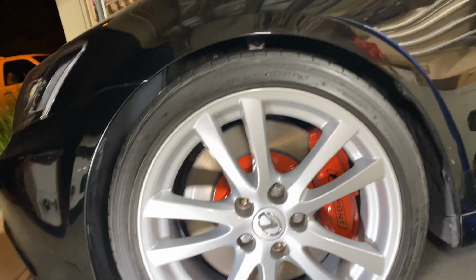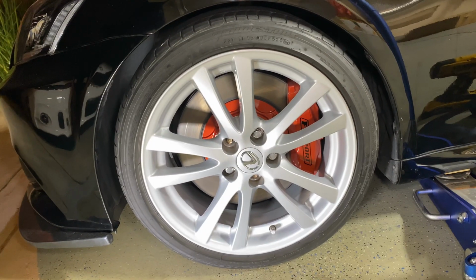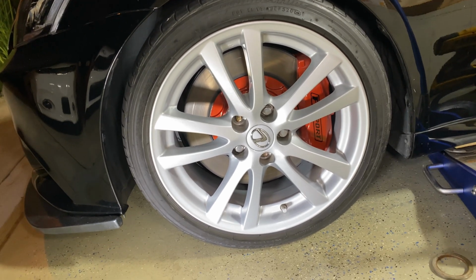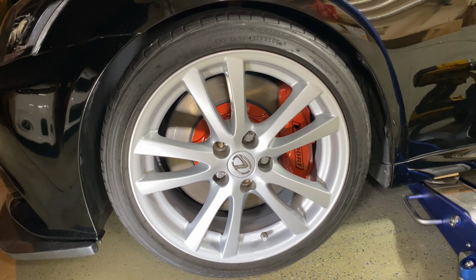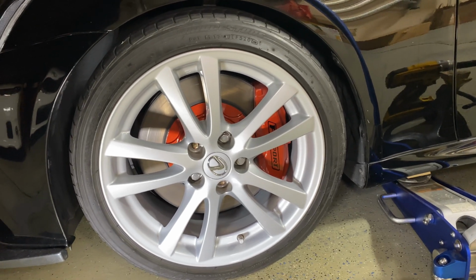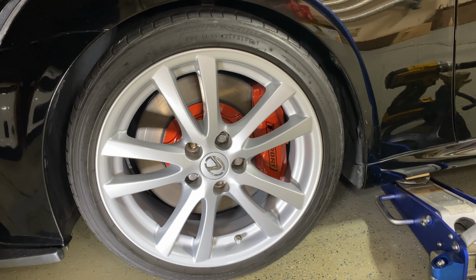Look at that, the wheel gap. I think when the suspension travels, it'll end up cambering in, so it won't rub as much. But if it fits my 245s on my 20s, it should fit 225s on these 18s if I had to drive. At least I found a solution, and it works, and I'm happy with it, as long as I didn't have to buy 19s or another set of wheels that's going to sit around.